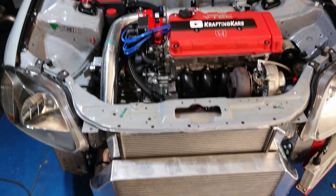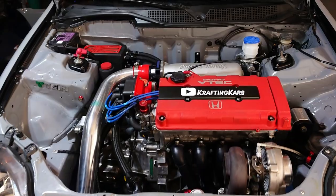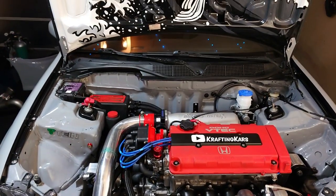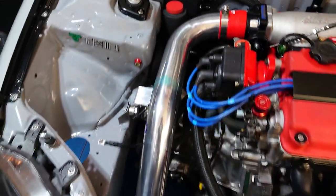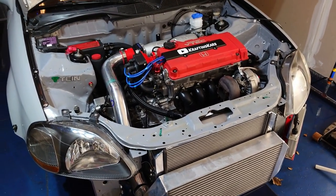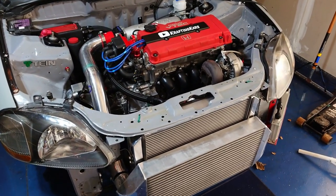Alright, so we've got everything mocked up. As you can see with these backdoor style intercoolers, the intercooler piping layout is very simple. Most eBay turbo kits you buy online will have the intercooler piping coming down, around, through the hole on the side, back to the intercooler, and then through that hole and up into the turbo — all that extra piping just makes your turbo spool up slower, and nobody wants that. Running three inch intercooler piping can possibly cause your turbo to spool up slower, but when your charge piping is as short as ours it shouldn't be a problem, and with three inch charge piping we're capable of making a lot more power than I'm ever going to push this motor to. Now it's time for me to carefully remove the intercooler and piping without removing the tape, bore out the hole for our blow-off valve, and take everything to a nearby shop to get it welded.